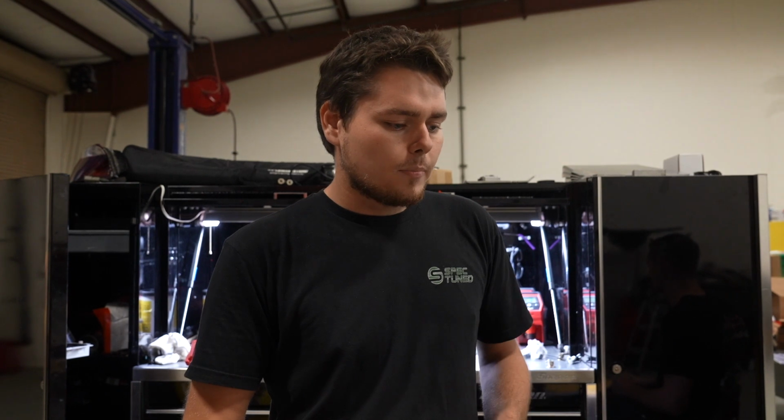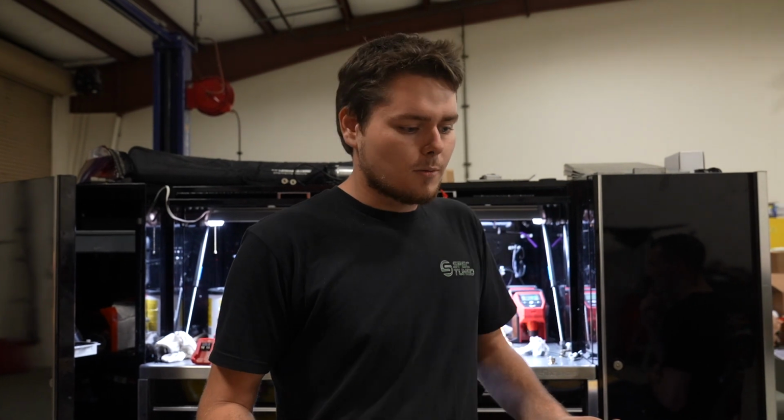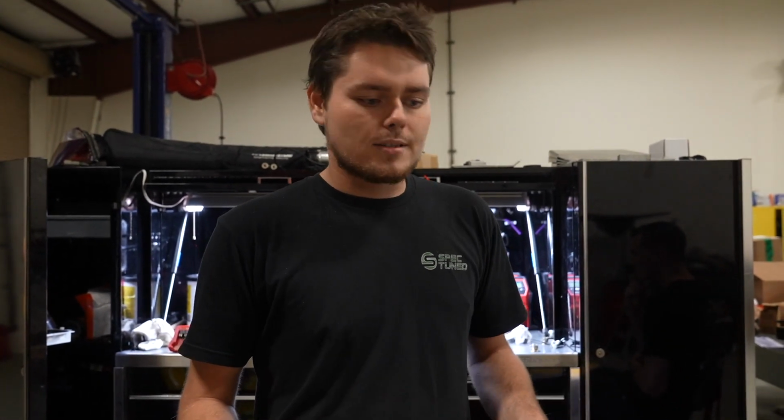The knuckle will help by removing a couple other suspension arms to reduce anti-squat, and that will give us more suspension travel. Currently, the car has under 3 inches of compression from ride height to when you hit the bump stop due to how big the tire is. So we're gonna have to raise the car even more to get more suspension travel out of the chassis. It's not gonna look cool, but hopefully it'll work better.